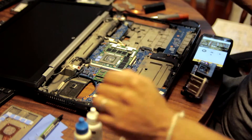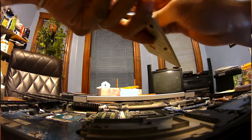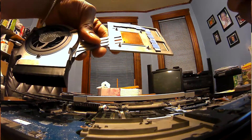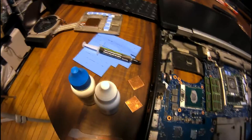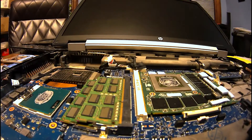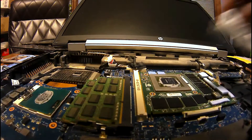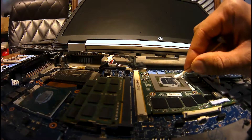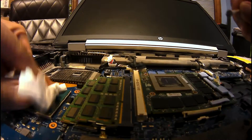I like to clean off the excess ahead of time just to make things easier, plus the chemical remover I use is pretty expensive. Now I'm going to clean the GPU heatsink — I recommend you clean that off too. Be mindful of the thermal pads because they are hard to find; I was able to find some and I'll leave a link in the description. The goal is to make sure you get rid of all of the thermal compound, because old thermal compound residue will actually cause your temps to go up.